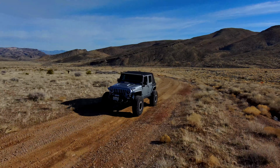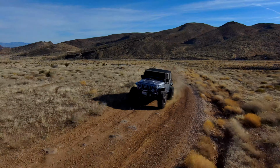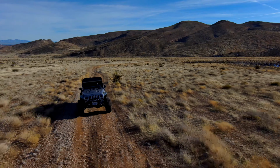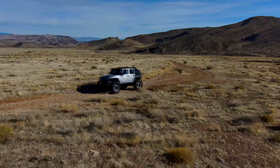Back in the mid-2000s, the L92 came out. It was mainly in the high-end Denalis and Yukons. The L92 was a great motor. It was an all-aluminum VVT engine. GM ran that motor in 2007 and 8, and then in 2009 they added flex fuel, which went to bigger injectors. They also changed the map sensor out to a Bosch style, which they maintain right up to this day, and they called it the L9H.